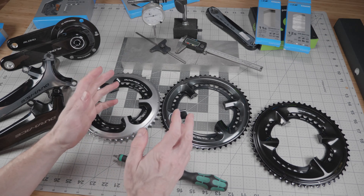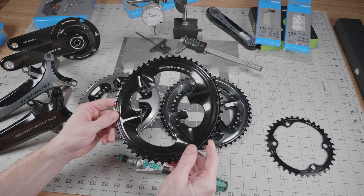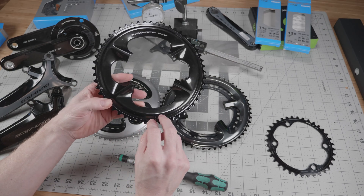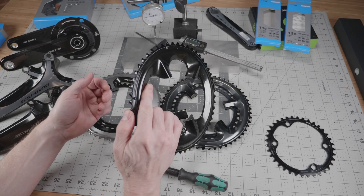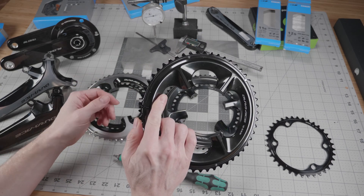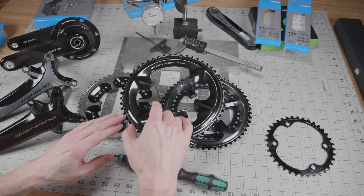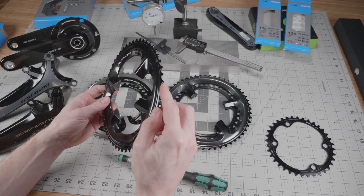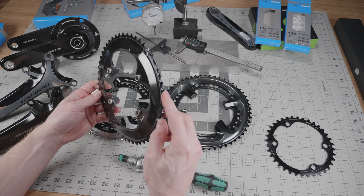With the narrower chain on the inside, you would expect the new 9200 chainrings to have narrower teeth. It's difficult to measure these because of their conical shape, but all the measurements I've taken and eyeballing one chainring right next to the other, I can't tell any difference between the size of the teeth on the 12-speed chainring and the previous 11-speed chainrings. There is absolutely a different cut on each tooth which benefits the new chain, and you'll get better shifting from both the different cutting and the different lift points on the new 12-speed chainrings.